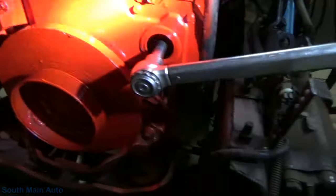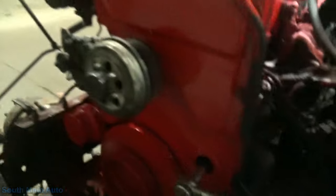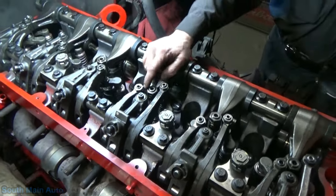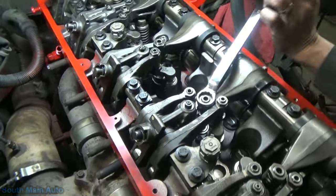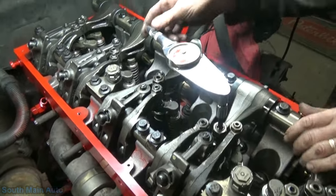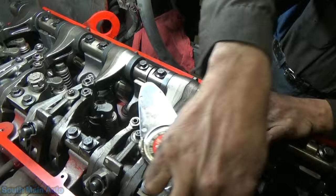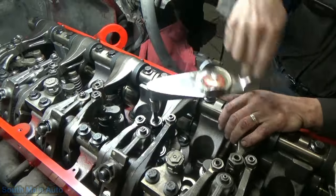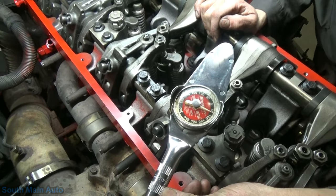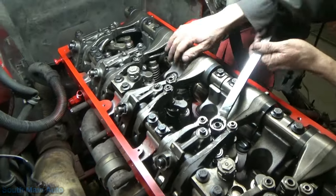We just did the video on the old Honda where we had to do a leak-down test — she didn't have much compression: 60, 90, 125, and about 175. Alright, this one's actually tight — we'll do the injector first. In firing order we went one, five, now we're on three. That other one was just a little tight. Cummins procedure says to back it off and plunge it twice — we do it twice.